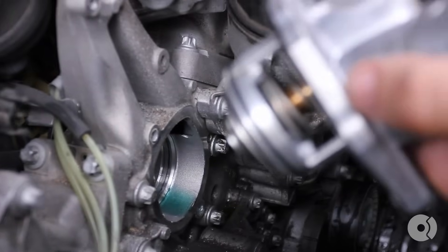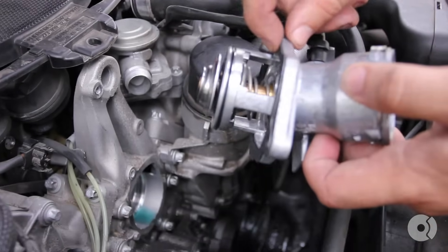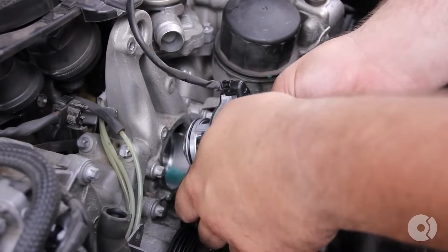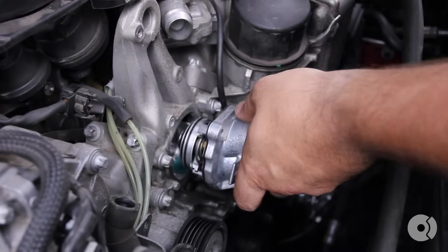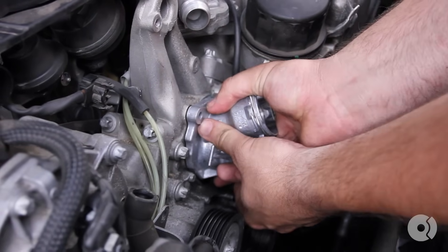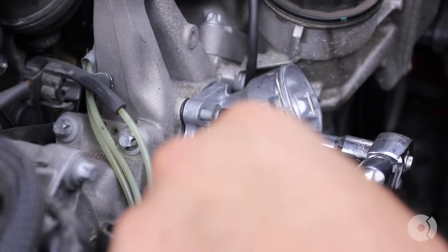The first thing we're going to do is connect the electrical harness — that'll just clip into place, simply push it down. Now you want to make sure you have a new gasket, make sure the seal is on and aligned. Now comes the slightly tricky part of orienting this correctly, and it just kind of pushes into place. The torque specs on this thermostat are very low, so honestly hand tight will be good — don't go too tight, snug is really all you're looking for.